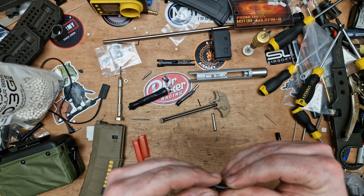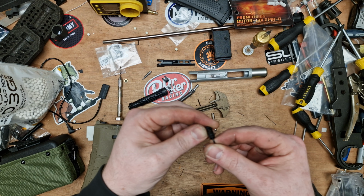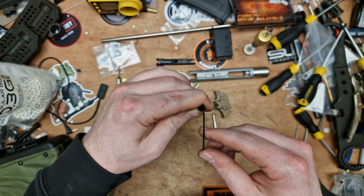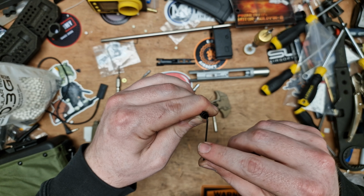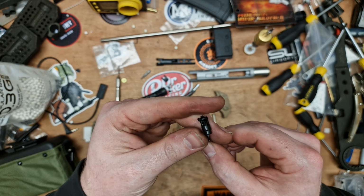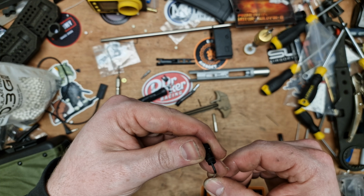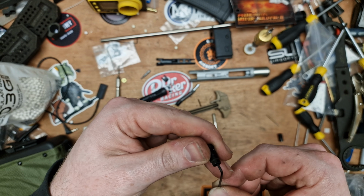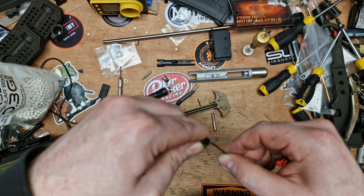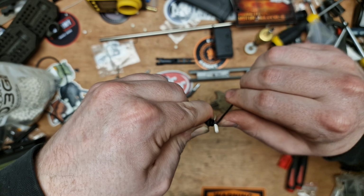So I'm going to switch to just an Allen key now. And the way I'm going to do it is I'm just going to look where the Allen key clocks like that. Okay. So I want to go down 0.4 of a joule. So that's 1, 2, 3, 4. So 2 turns. So I'm just watching where this is. This is kind of lining up. See if I can line this up a bit better with another part of the valve. So it's just before that section there. So I want to go half, 1, 1.5, 2.